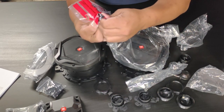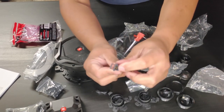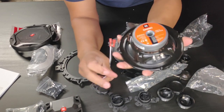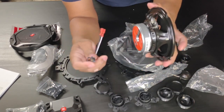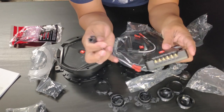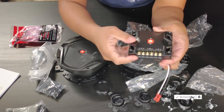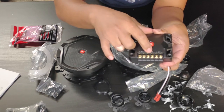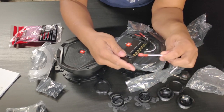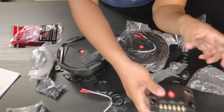Now we're looking at the wire kit — this allows us to avoid cutting any cables, which is important. The plugs connect directly into your factory harness, and then you have two pigtail ends. We'll cut those and run them into the crossover box as the input, with highs and lows separated. This makes the job very easy — plug and play, no soldering, just screw the wires right down onto the terminals.